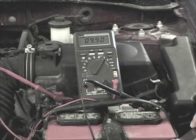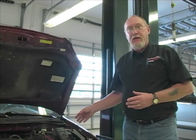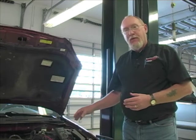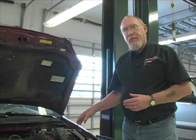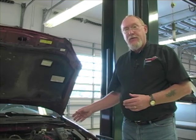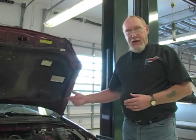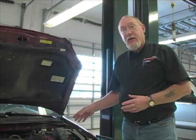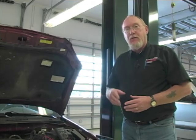The high side shows that our charging system seems to be functioning normally. Now, have we discovered any weak spots? Maybe the voltage wasn't reading like we expected. Does that mean the battery or the system is no good? Not at all. Because if you look at where the meter leads are placed — they're placed on the terminals and not directly on the battery posts. Where there's a weak connection between those two, that's a common occurrence, and that could cause voltage drop issues that would affect how the system operates. So we need to make sure that's okay, and we need to check some of the other voltage drops in the circuit as well.